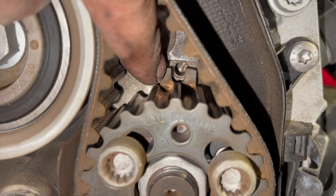So, as I said earlier on, the pulleys are loose. I've just sat them into the right hand position there. I know that the actual main camshaft through the pin there is locked solid, and same again with the fuel pump. It's just over to that right hand side, and you can just see the locking pin on the crankshaft is in there. And just double check, if you're a little bit unsure, make sure again that the line on your pulley lines up with your little arrow on your tool there as well. Obviously this can't really come out because it's slid in, so you know it's pretty much bang on if the pin's still in line there. So it's always just nice to double check quick.